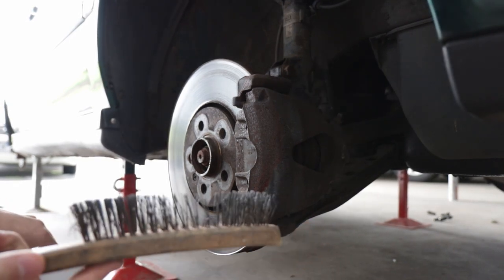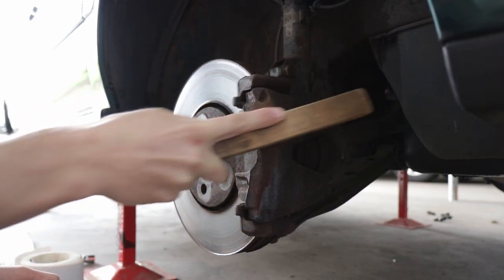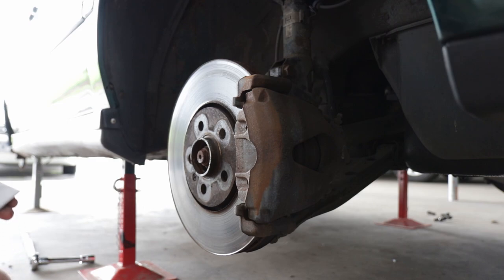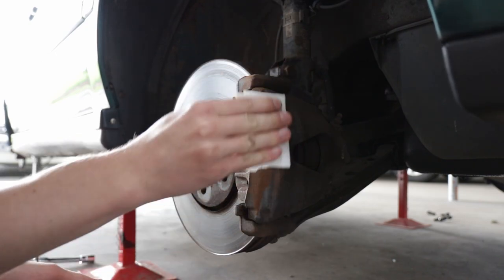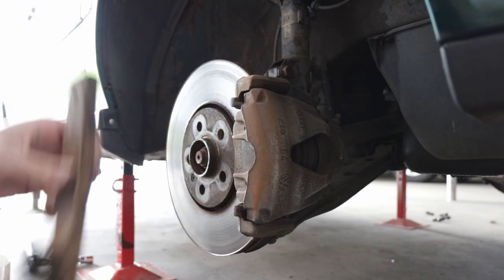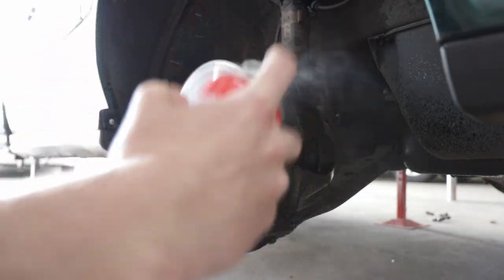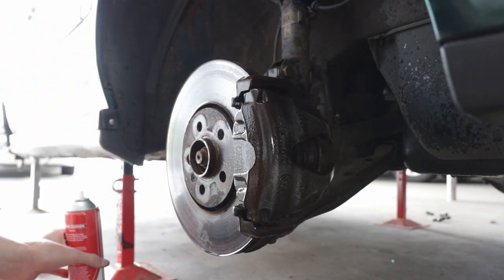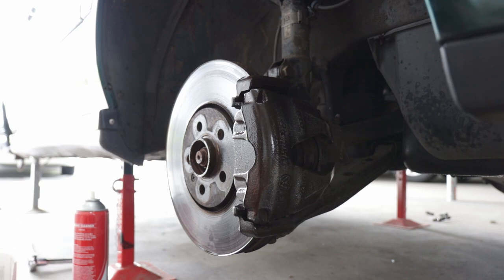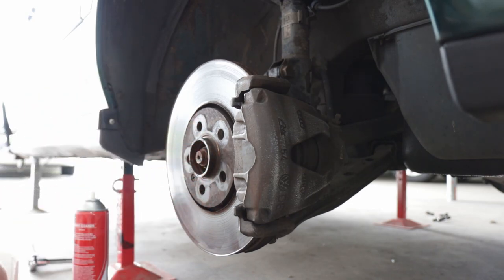This is probably a good spot for a dust mask — I don't actually have one with me, but we're just going to start brushing all around the calipers. The alternate to the wire brush is sandpaper as well — just using basic tools here to show you how easy this is to do at home. Now that we've smashed the caliper down with a wire brush followed by a bunch of sanding, let's get some brake clean, spray it on, and clean this caliper right up. What I'll do now is grab a rag and wipe over it to help it dry and remove as much of that surface dirt as possible. Our caliper is looking significantly better than before. We're now going to move to the rear calipers and repeat the same steps, and then we are ready to paint.